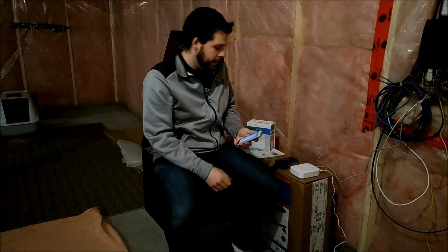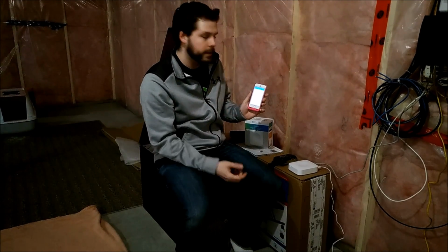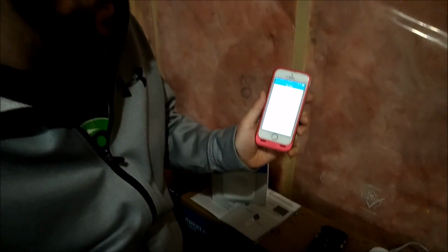And then what you want to do is go on the SmartThings app, and when you get in there you're at your home place, right? So when you're in the home place, on the iPhone at least, you have these three lines down on the bottom. Touch those, and then you can go to the Hub is Online, touch that, and then Z-Wave Utilities.